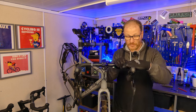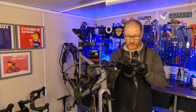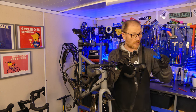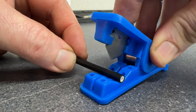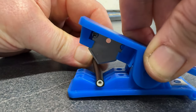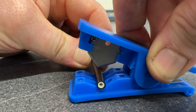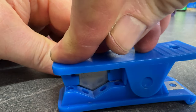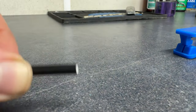We've measured and triple-checked it, and we can confidently say where we're doing our cut. The most important thing here is that the hose must be at a 90-degree angle to the blade. Squeeze down, cut the hose — double and triple check it. That's perfect.